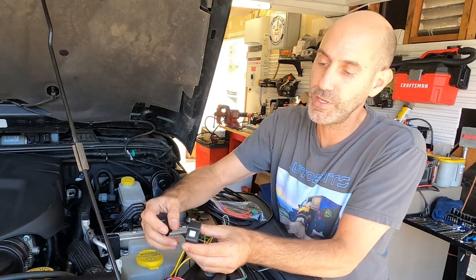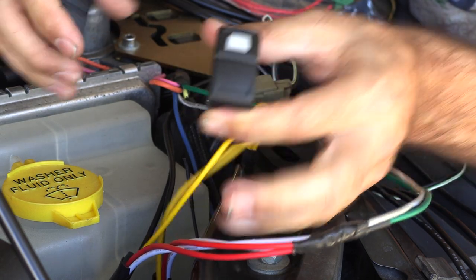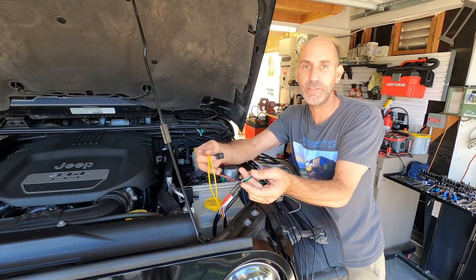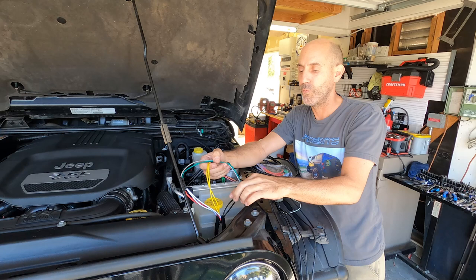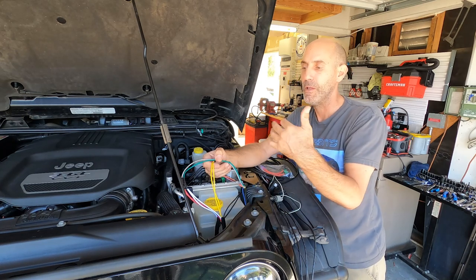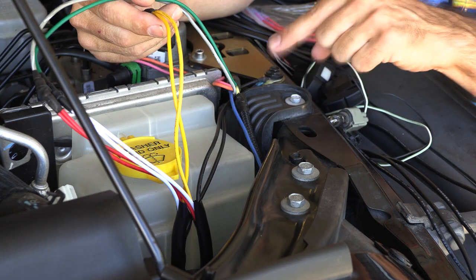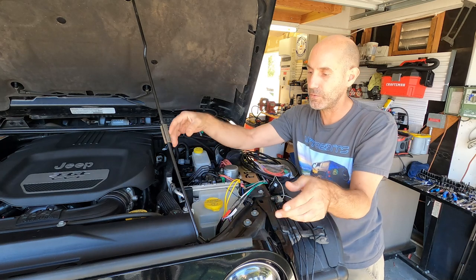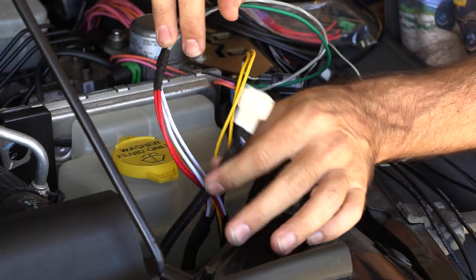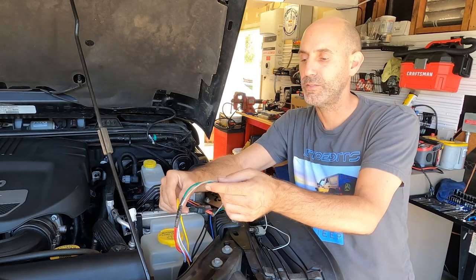Here's an example of a few different switches. The stock switch in my setup is a simple off-on. A momentary switch goes back to off. But that's the basics for power. Because I'm a stickler for running really solid ground wires — a lot of people overlook that and underground their 12-volt systems — the ground wire carries the same current as the power wires. So I have a discrete ground wire going to the system. I now have a ground wire for the rock lights, and I already have a harness wired up from the Painless. Wire three on the switch panel will run the rock lights. We still have a lot of work to do on that, but that's the basics of how I'm setting this system up.